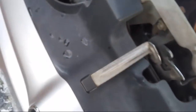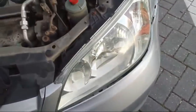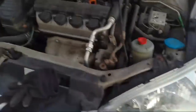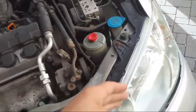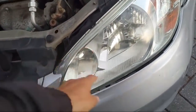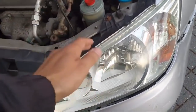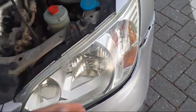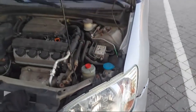There's another radiator hose down there — it's a little awkward to grab without hurting myself. It can get a little hot, so that's why I'm wearing the gloves. Check this out — I restored my headlights. Look how beautiful they look, how sharp and clear. I used rubbing compound for that — $6 from Home Depot. I put a little water first on the headlights, got off some of the dirt, wiped it off, dried them, then put the rubbing compound with paper towels on there, rubbed it on real hard. It dries quickly so you've got to keep putting more on, then wipe it off. All the yellow film comes off. I've done this like three times in the last two or three months.